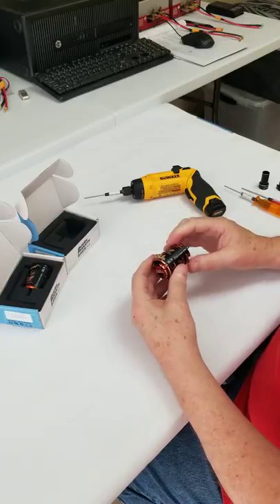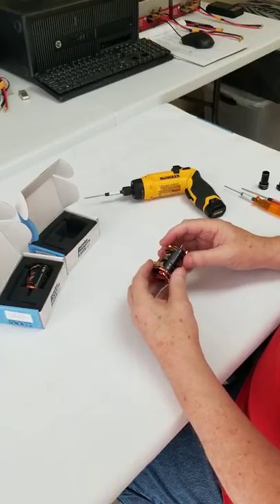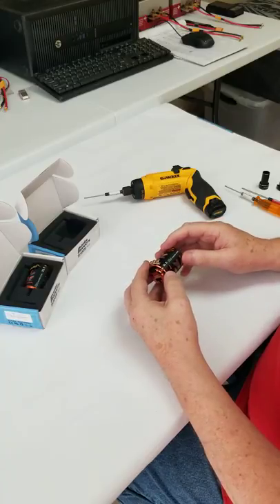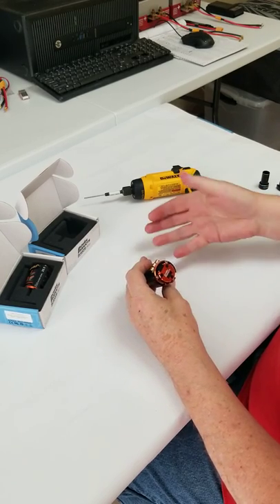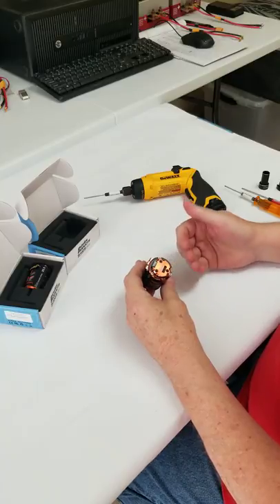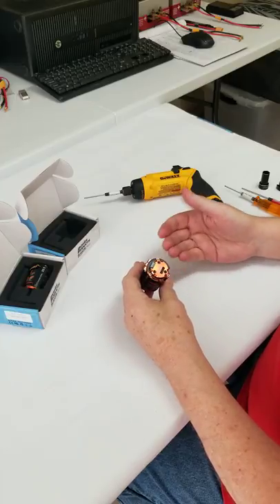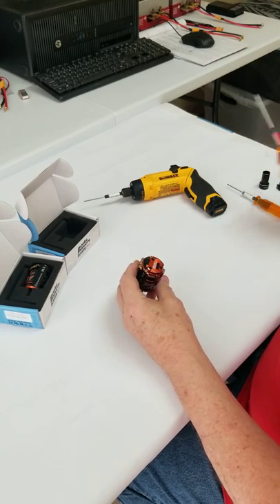So far they look pretty good, but these are just like all the other R4 motors I have. They come apart the same way. These are the stock spec motors, so they look the same from 21.5 on up to the 3.5 winds that I have. Starting is really very simple - these three screws on the back are what actually hold the whole structure together, and these screws are all aluminum 7075 hardened aluminum. I don't charge extra to replace those because most motors come with steel, which actually takes torque out of the motor. I try to put power into the motor and these aluminum screws come apart very easily.